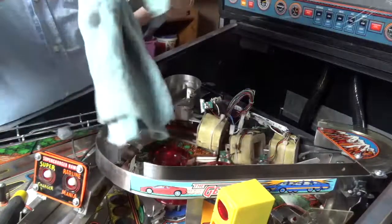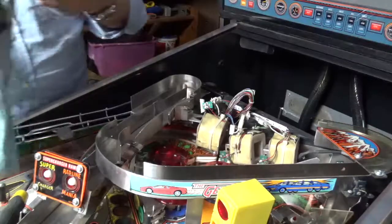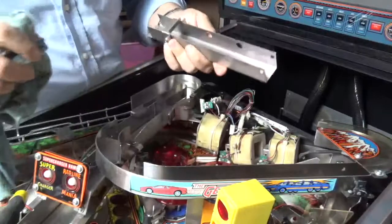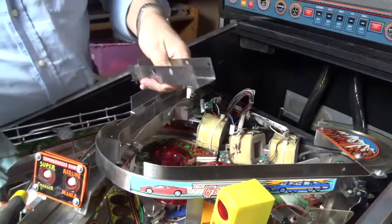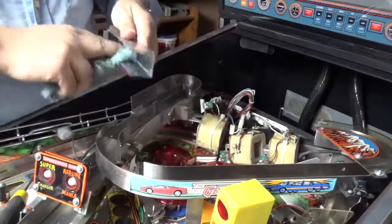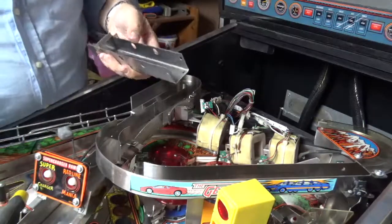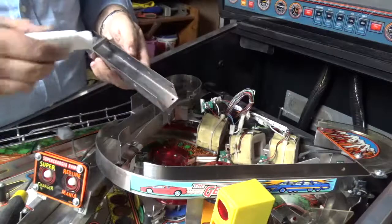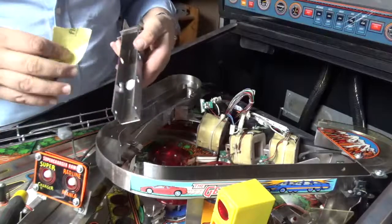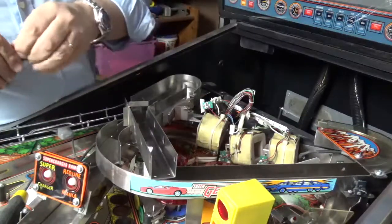But the areas with severe wear are not going to smooth off, and maybe that's good enough, to be honest, but who knows. I'm going to try, and for lubrication I'm just going to use a bit of Novus 3 with the sandpaper. It's a trick that I've got from Shaggy's videos. If you haven't had a look at those, do so.